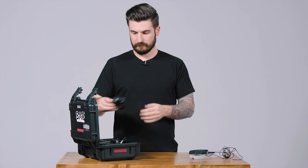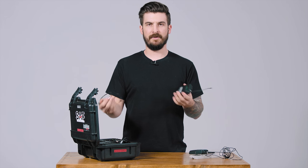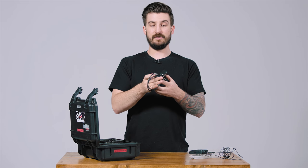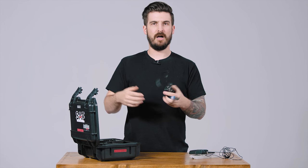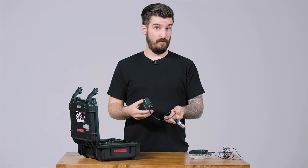Your receiver will go into your camera. If you have a DSLR or something that doesn't have XLR inputs, you'll use the three-and-a-half-millimeter cable. If you have a nicer recorder or camera, you've got your XLR connector — same thing, screw it on, plug it in. Usually this just kind of works.